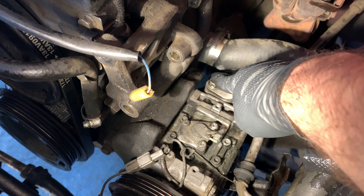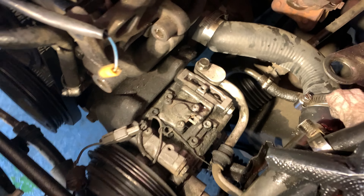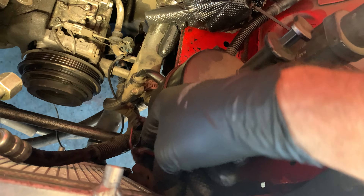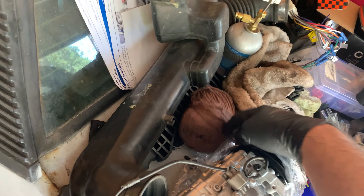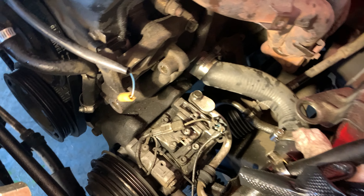You need to pull the lines here — there's a bolt down on the bottom you've got to be underneath the car to get to, and then there are four bolts on the compressor. There's an electrical connection that goes up to a connector which I just ripped right out because the new compressor comes with that wiring already. Over here is the new compressor — it has that connection and all the electrical stuff already on it, which is really good because I can just take it all out with the old compressor and leave it out.